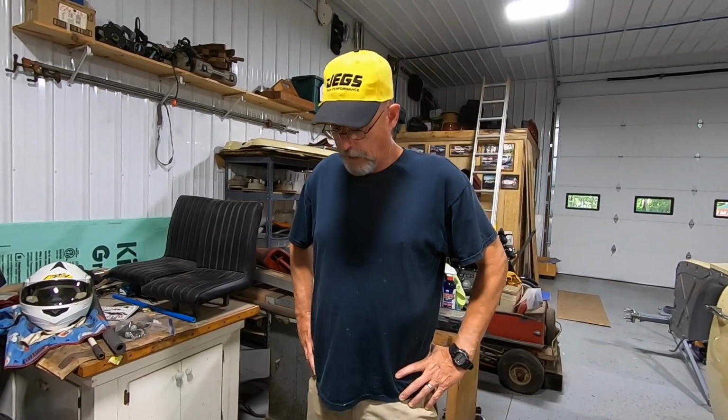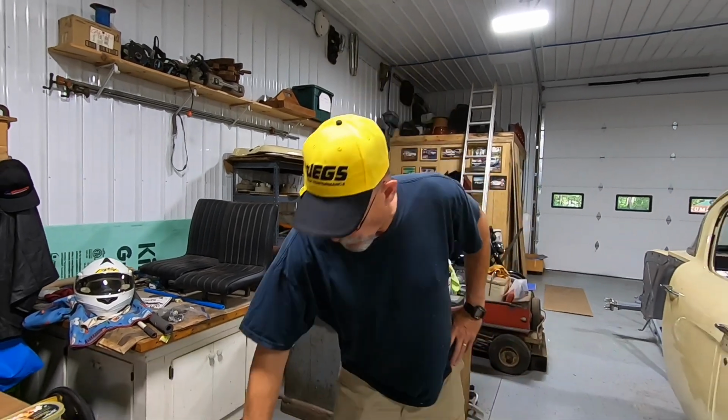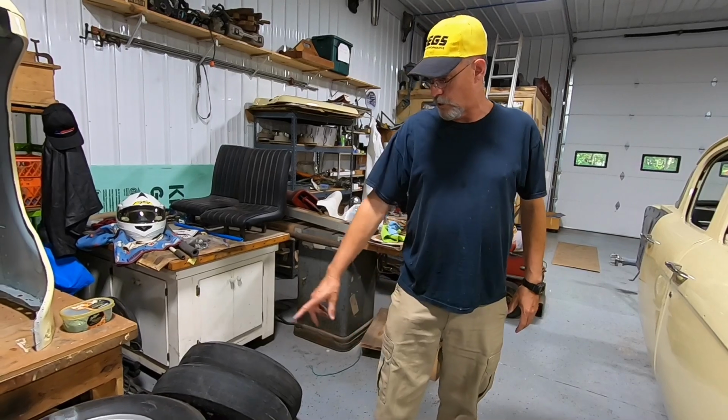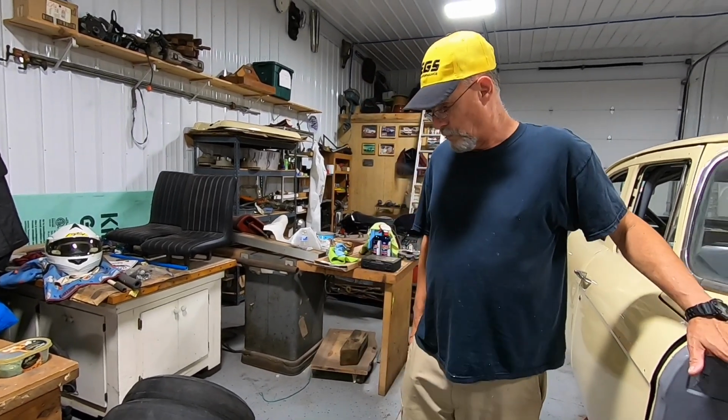And with these small engines, the last thing you want to do is put too much slick on them, because if you dead hook the engine and kill it right on the starting line, they'll just never recover. They just don't have the capacity to recover. So anyway, we're running a little 7-inch, it's a 29-inch tall, 7-inch wide, 15 super stock slick.